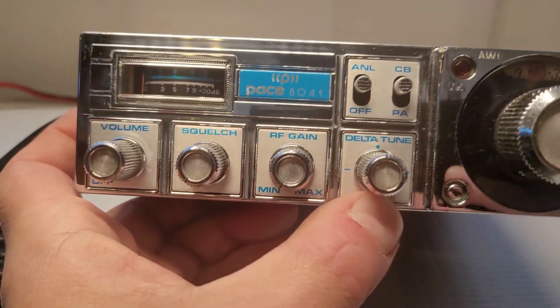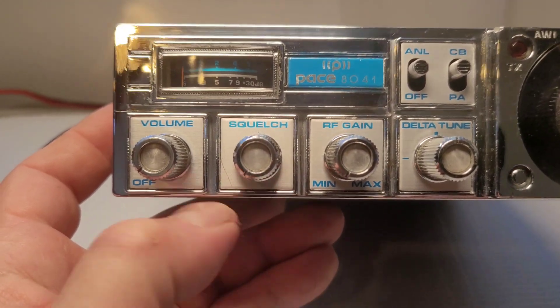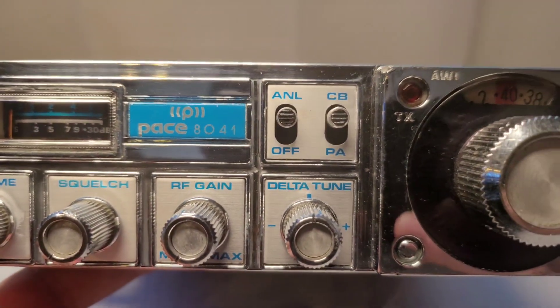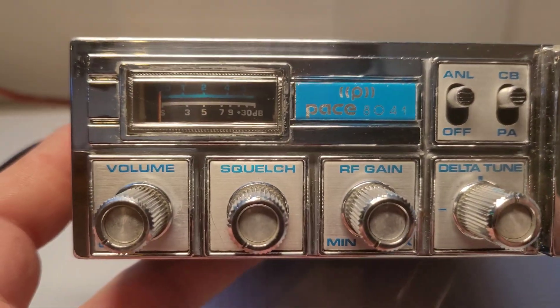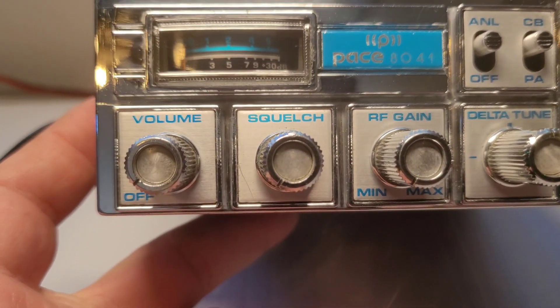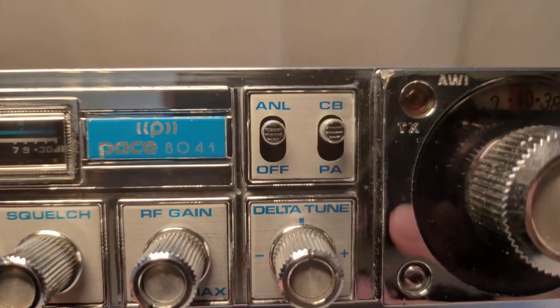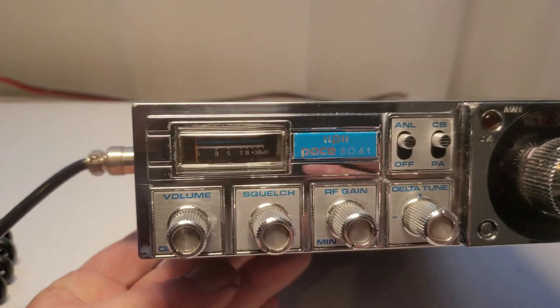I made sure I didn't get any polish on the aluminum, and only did the chrome, because it'll definitely discolor the aluminum inserts inside these squares. So if you use any sort of metal polish, stay away from the aluminum because it will discolor it and you'll end up polishing that silkscreen away — just something to look out for.